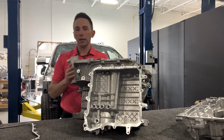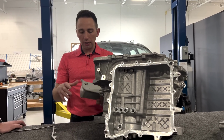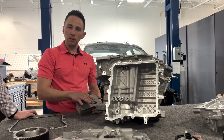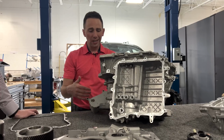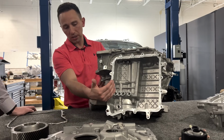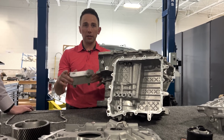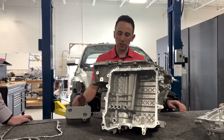But it's cooled via ethylene glycol, and then we've got this separate plate cooler that's used for the gear oil. I thought it would be very cool if they were able to integrate the plate cooler closer to or part of the inverter, such that the ethylene glycol loops did not require separate hose runs to and from the inverter and the plate cooler. They're so close yet so far, proximity-wise relative to one another. They're within, I don't know, less than a foot away from each other vehicle-wise, but we're not yet integrating the coolant loops. So in another iteration, I would like to see some level of integration there. I think it would be cool.